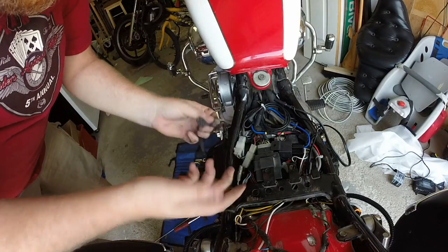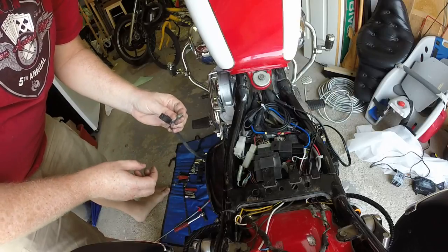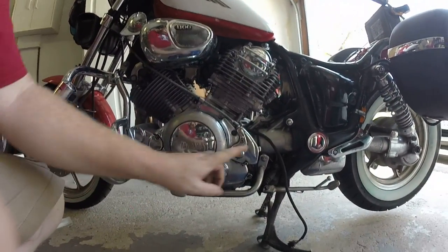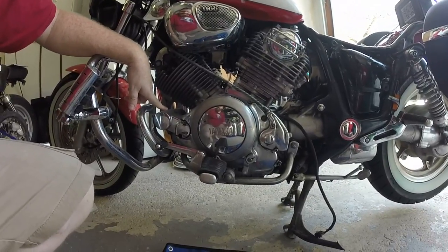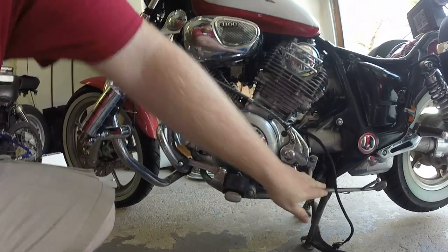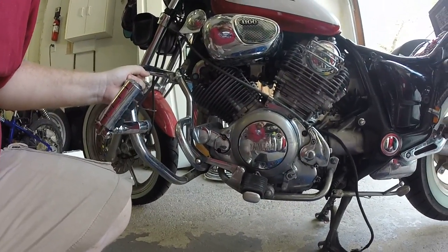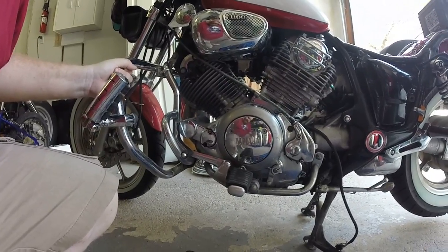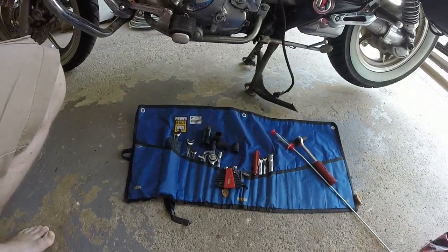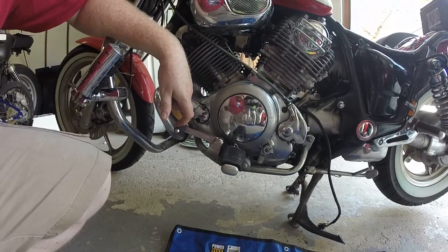There's also a little pigtail — I'm not sure what it's for, maybe an extra ground wire. You're going to have a fun time now because you have to drop the oil, take the clutch cable out, disconnect the starter solenoid, remove the shifter, your guards, engine guards, and highway bars if you've got them. You have to take half the bike apart to get at the stator. You'll need a T30 Torx bit — it's not included in your standard kit.